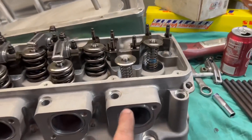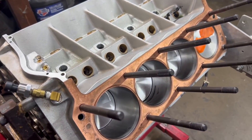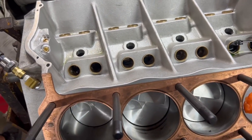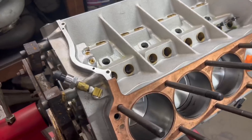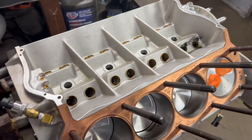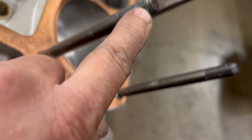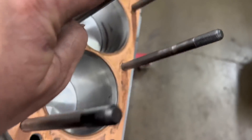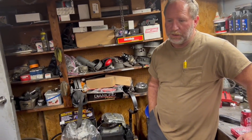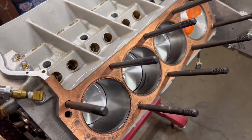We're going to stick the spring back on this one so we don't have to worry about that, and then it's just a matter of ordering the correct length push rods and head gaskets — once those are on, we'll be ready to roll. The head studs are just a tad long on the bevel, so we'll have to knock the bevels down off the top so they clear. The clearance was only about 18 thousandths — if we put a 10 thousandths thicker head gasket on it it'll clear, so we may just do that.